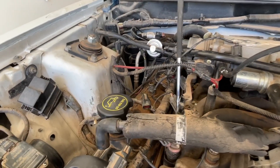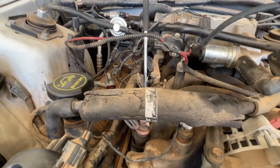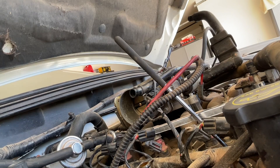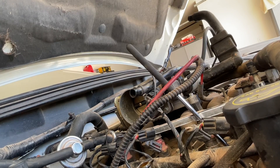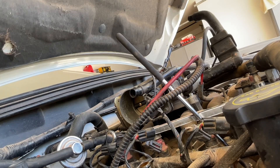This is just a long pull. As I'm rotating the crank, I'm watching it rise, and then eventually it will come and start to fall again. I've sped up this footage — that's how you'll know the piston's at top dead center: it will come up and then come back down. As it comes to the peak, you know you're getting to top dead center. As it starts to lower, you know the piston's on the way back down, so you'd basically put it between the two of those. Checking this against the crankshaft, it was on — so I know the dampener mark on the crankshaft pulley was correct.